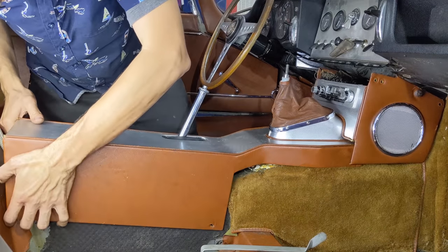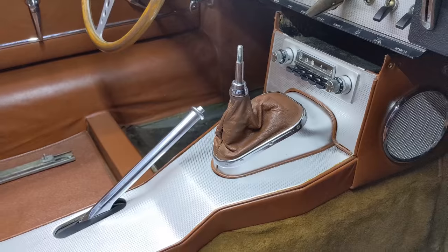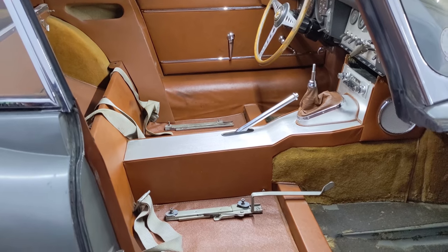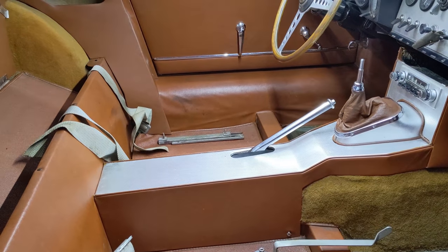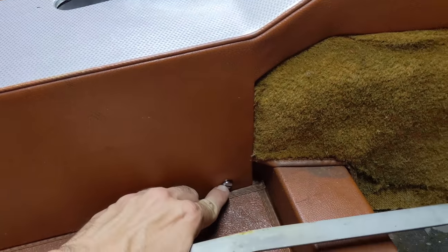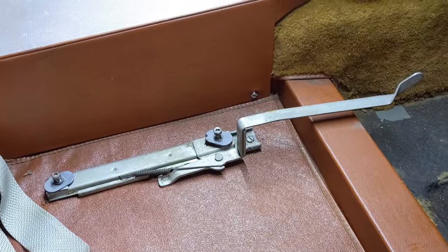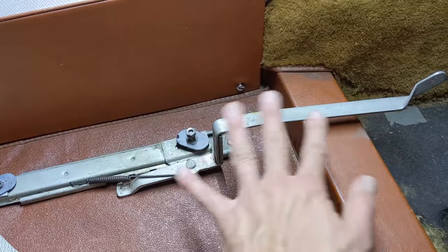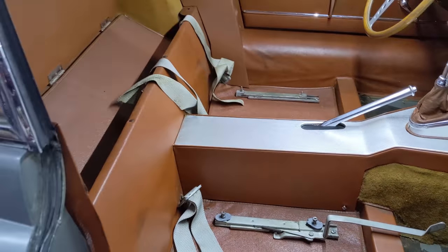Got to be so careful with this original upholstery. Look at this interior, everybody. If there was ever any doubt to preserve this car, I think this interior really answers the question — I am so happy we didn't rip all this interior out and replace it with modern substitutes. It is absolutely amazing. Got the center console in, held by three chrome machine screws. Also put down the upholstery underneath the seats — I noticed it was set up incorrectly but there was a witness mark on the pads showing where the thick washers went. These seat tracks are in exceptional condition — look at the original cadmium. Didn't need to refinish them.